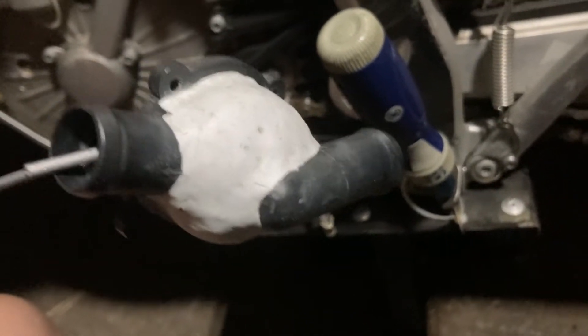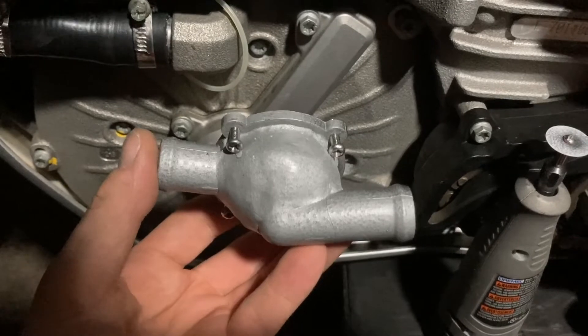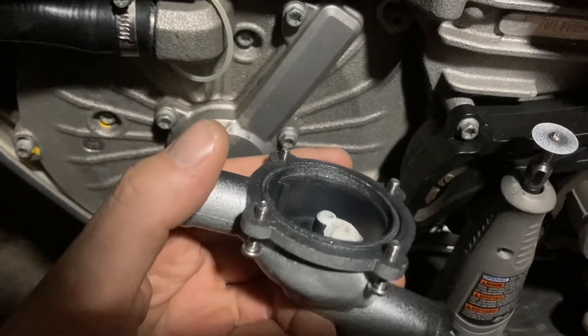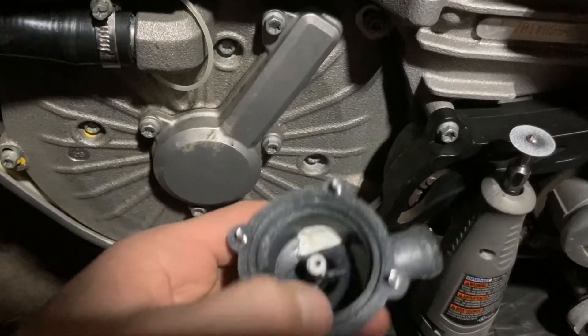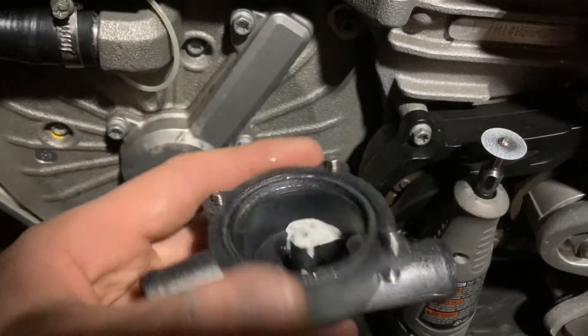Later that night — it's all set up now and I got it sanded a little bit to prep for paint. We're going to spray paint this aluminum, kind of silver colored, so that it matches the engine case a little bit better. We got our piece done — got a paint job on it, though the spray paint came bubbling out of the can since it was at the bottom. On the inside you can see we've got the little post thing rebuilt and ready to go, all the JB Weld smoothed out so water will flow freely. This thing should work — we're going to give her an install now.